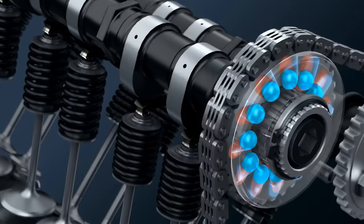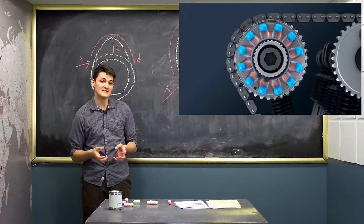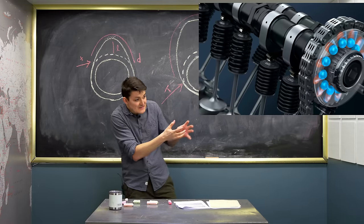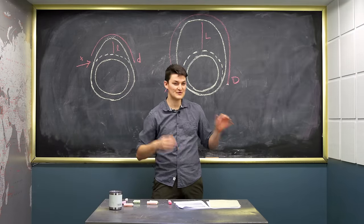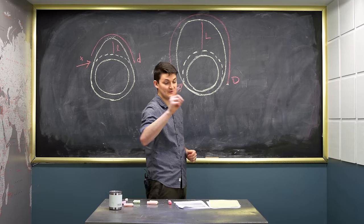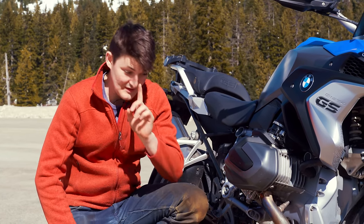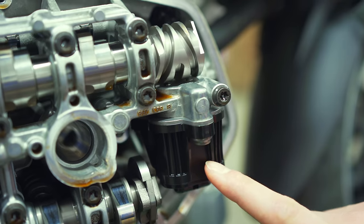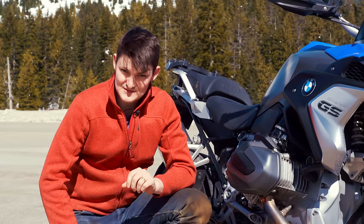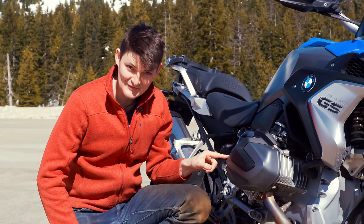Now there's a technological revelation. Suzuki's latest centrifugal system is closer to CVVT — continuously variable valves. It optimizes timing only, but across a smooth spectrum, which is better than the two-trick pony BMW is running. Not least of all because it's purely mechanical. Metal needs to break for the Hamamatsu design to go bad. Whereas our Beemer relies on a computer-controlled solenoid to shift from one cam lobe to the other. Electricals. In here. That works fine until it doesn't.